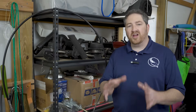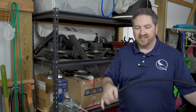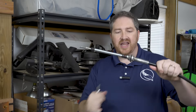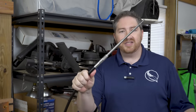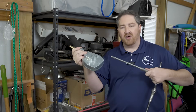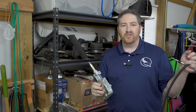If you're working on the steering for a jet boat, the cable is going to look a little bit different than either a rack and pinion or a rotary steering system. This is a cable for a jet boat steering system, and what you'll notice is that both the engine end and the helm end of the cable have a threaded end. This is the engine end — it has this large nut that connects back to the bulkhead and moves the jet back and forth to steer the boat. This is the helm end of the cable, and here is a jet boat helm. There's additional hardware that connects to the helm, and the threaded end connects to that hardware. When you're turning the steering wheel, that engages the cable to push or pull it and move the jet at the back of the boat.